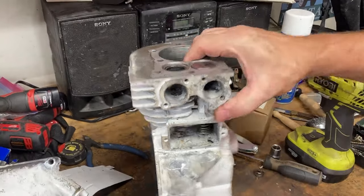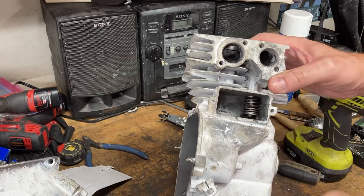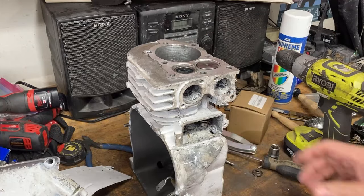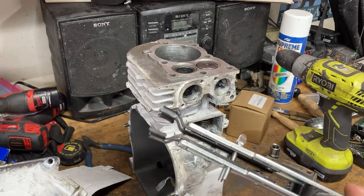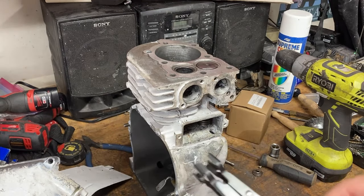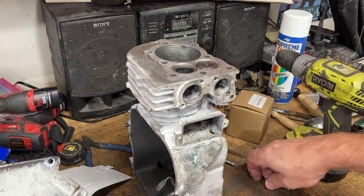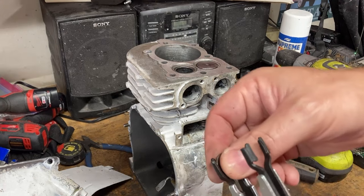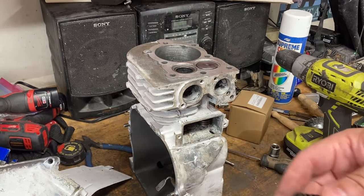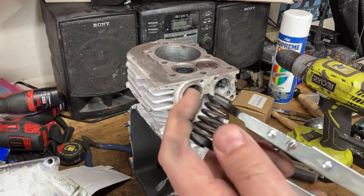Okay, so we're installing the valves. We have the intake valve installed, and the spring and the keeper are in there. Now, to do this, you're going to need this special tool. It's a little small engine spring compressor, and I'll put a link in the description below for this. But one thing to keep in mind with this, when you go to load your spring, you want to make sure these are reasonably tight in there. And whatever you do, don't take your finger off the end here.